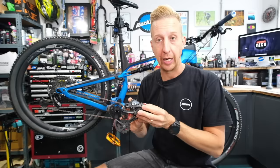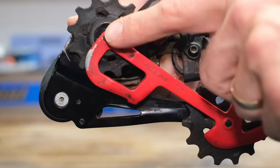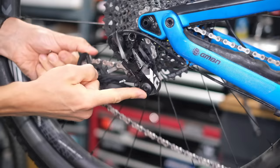Before we get started making any adjustments to this bike, let's take you through what the SRAM derailleurs look like. The function and form is essentially the same as most other derailleurs on the market, but they do have a few small features to set them aside. The basics look pretty similar: you have a lower cage unit with two wheels — these are called guide wheels, jockey wheels, or sometimes pulleys. They rotate on little bearings, and the responsibility of this cage is to take up the slack in the chain when you're in a higher gear.